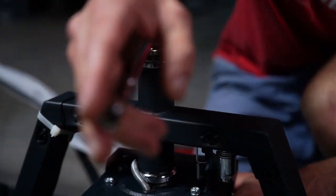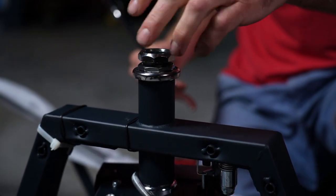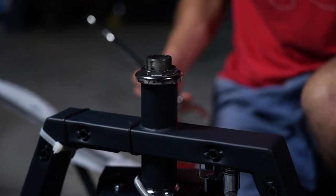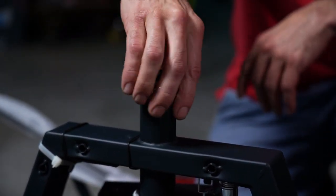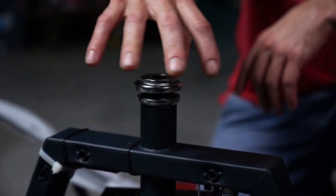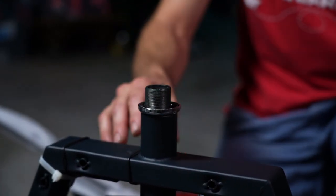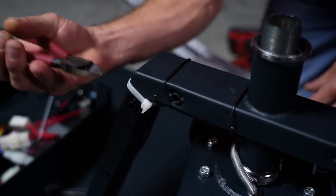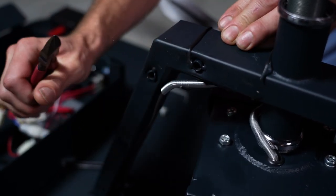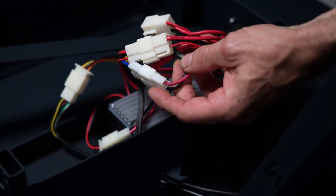Spin the fork until it stops so you have a little resistance while unscrewing. Unscrew the top nut, then the second nut. Before dropping the fork out, make sure you've removed the motor's wiring — use snips to cut all the zip ties off the factory chassis, making sure not to snip the wires. Under the battery compartment snip the wiring holding all the wire connectors together.